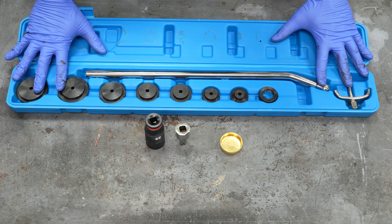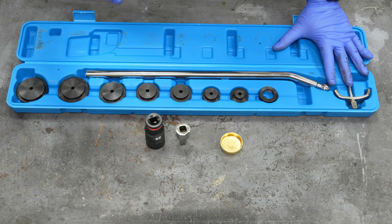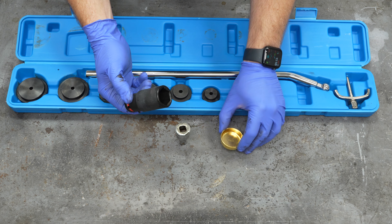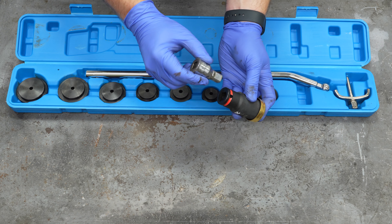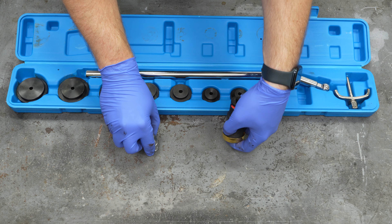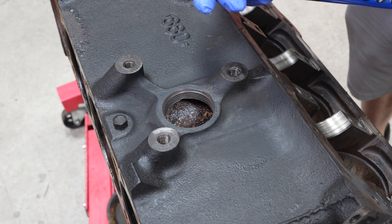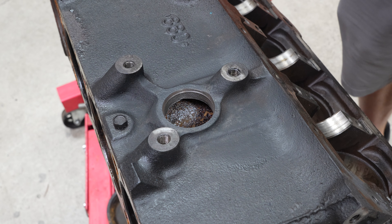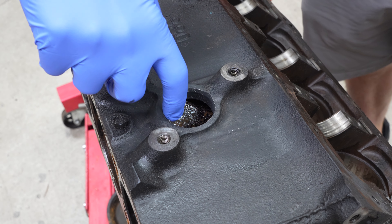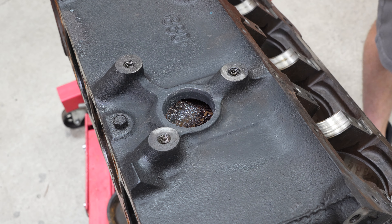Here on my table is the official tool to replace a core plug or a freeze plug — I'll leave a link in the description. This is for if you're in a really awkward spot and can't get to it by conventional means, which is using an impact socket that fits in the new freeze plug really well. I have this extension I've used over the years — you can see it's all mushroomed out — and you can just tap it into the block. But you don't always have access, so that's why this tool exists. I'm going to show you exactly how to use both. With our surface nice and clean, I'm just going to take some regular RTV. I like using RTV for two reasons: it lubricates the plug a little bit to make it easier to get in, and it provides simple sealing. Always wait until the RTV is nice and cured before putting water into the engine.